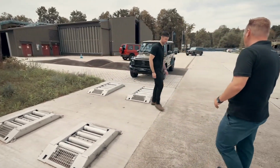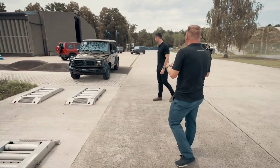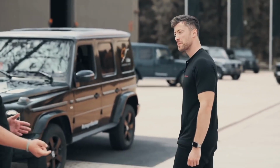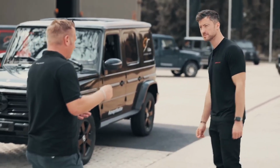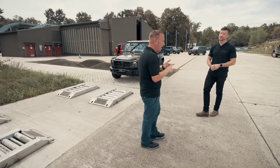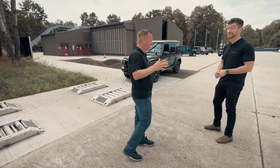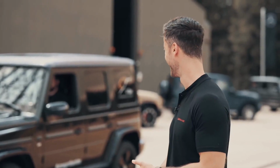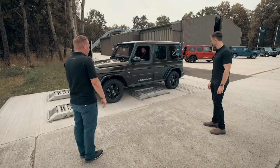Florian is in the car. When we go off-road, we always start with the low gear, with the reduction, and we always lock the center lock. Then we have no ABS, no ESP, no electronic help system. That's a real car now. So, Florian, please come inside.